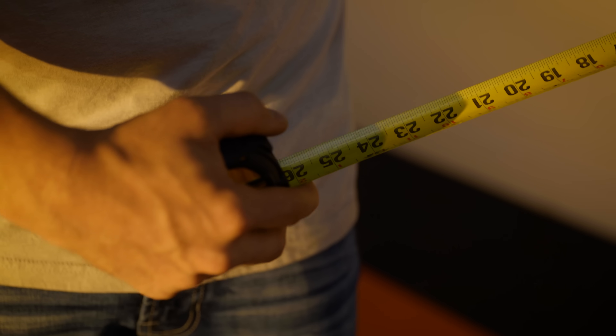What you see here is one headlight housing with your stock halogen bulb, 10 meters away from the wall. I'm measuring this with a digital lux meter. A lux meter measures the actual usable brightness at a certain point — it is very good at telling the difference in brightness or the percentage change from one light to another. If you try this test at home, your lux numbers will most likely be different because ambient light and distance affect the numbers. So pay more attention to the percentage change from one light to another.